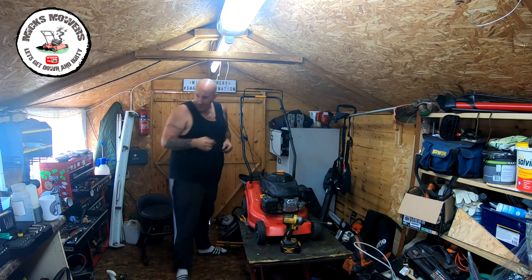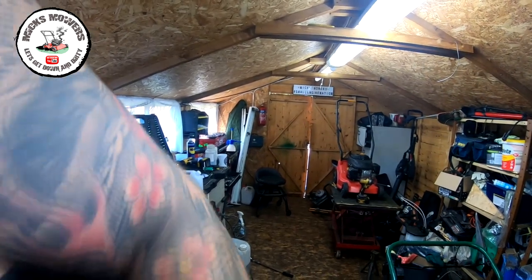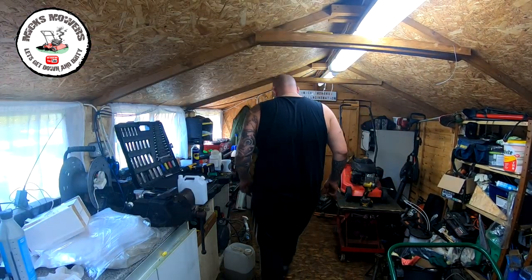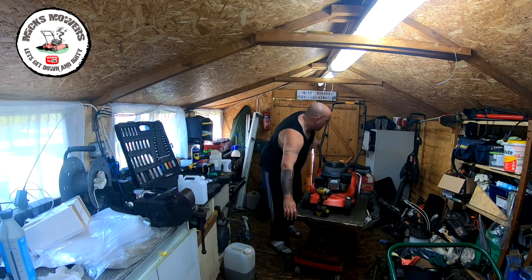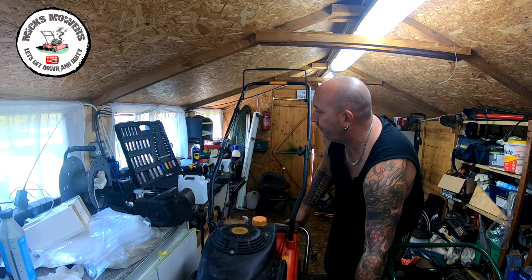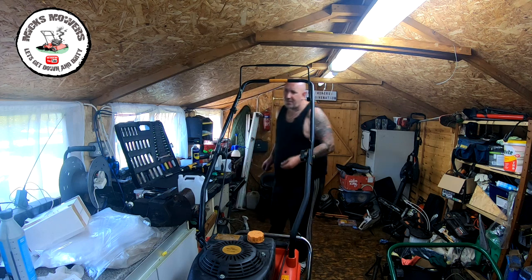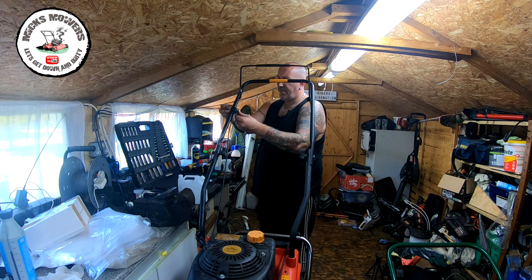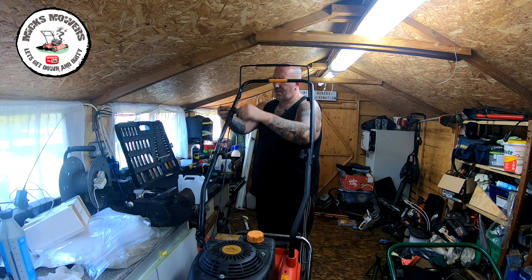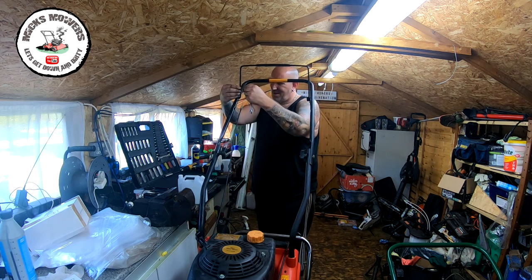So I'm coming over to the vise, which is just behind you guys. Let me bring you guys a bit further. That's it, somewhere in there. And I'll bring the lawnmower down through. Come on, Mr. Lawnmower. Down you come. All we're going to do is bring this all the way down to about there. I might just have to disconnect this 10 mil very quickly. And then we're going to do a cable fix on this just to take the slack up. So I'm going to remove a 10 mil bolt from there. Take that connection off. And we want about 20 mil, give or take.